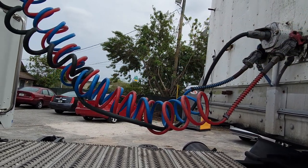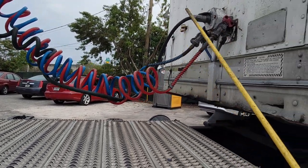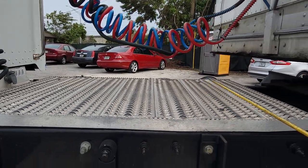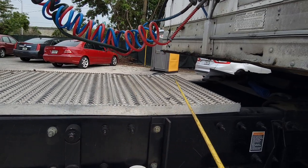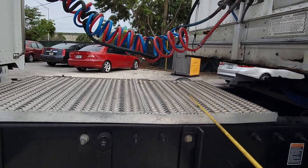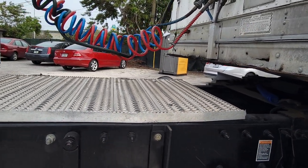No tears, no cuts, good condition. From there, give a quick brief explanation about your catwalk — it should not have any illegal holes or weldings, no rust, no cracks, good condition, not missing any bolts, and most importantly no oil, no grease. Keep it clean from any debris.